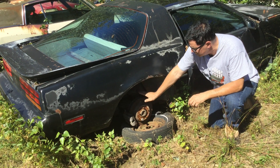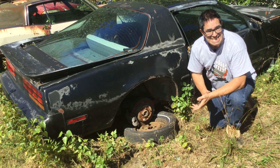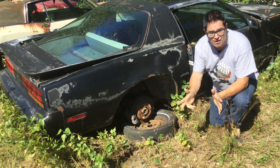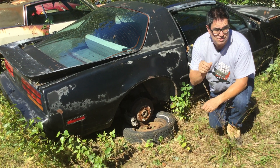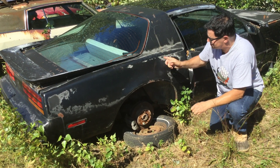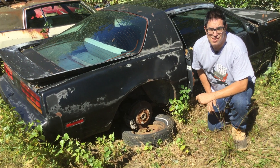So this is not to be confused with the Dana 44, although if you're lucky enough to find a 1991 or 1992 SLP Firebird Firehawk in the junkyard — which is not what this is, and that's a rare car — those came stock with the Dana 44. But short of one of those, this M78 Borg Warner rear axle is a major junkyard find.